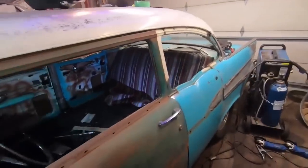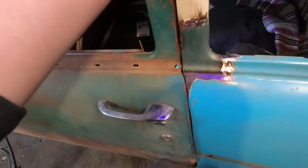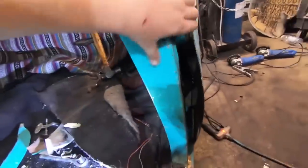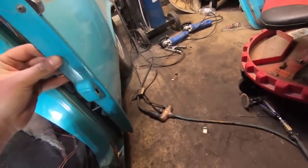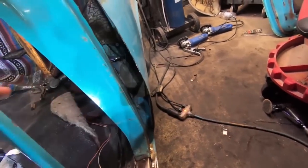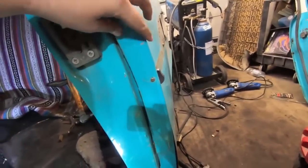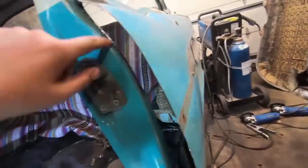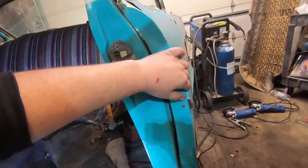Here's where I ended up — it's all pretty much back together. It could have worked out a little nicer there, but when the door is closed, I still got to do a little bit of screwing around with the gap. On the inside, it's just flopping around. This is the piece I cut out originally — I'm going to end up cutting that down, because this would have fit on there and been flush on the outside between the two doors and the four-door. I'll just cut it down, weld it back in, and clean up in here, and that will give me a nice look in there. Should fit perfectly.